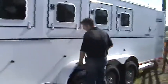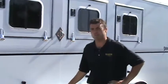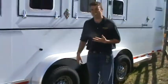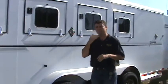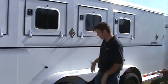One very practical thing we do is bolt on all our fenders rather than weld them. The reason is that fenders are probably the most damaged thing on a horse trailer, and this way they can be replaced at a minimum cost. We also don't put our lights on the fenders. Our lights are LED — one of the brightest, safest lights in the industry. They're very bright, you can't miss them at night, they're energy efficient, and they'll last forever.